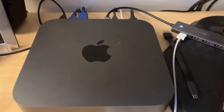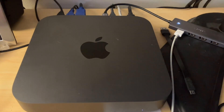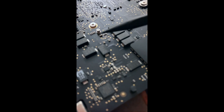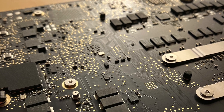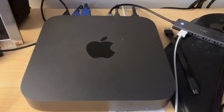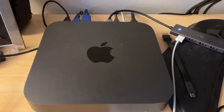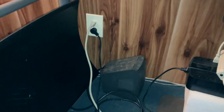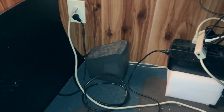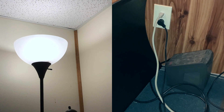I'm trying to figure out how in the world a Mac Mini could cause flickering lights. I came up to the Mac Mini — it's powered off — and started disconnecting everything but the power: KVM connections, network jack, two USB-C cables. Even going through and systematically unplugging each connection from the back, I was still having flickering problems on both my office light and the fridge, which leads me to believe it's something inside this Mac itself. I even opened up the Mac to look for loose connections or anything grounding out on the metal case.